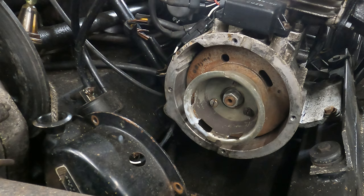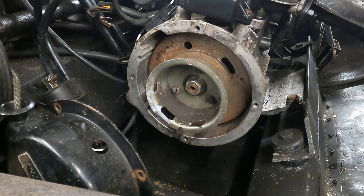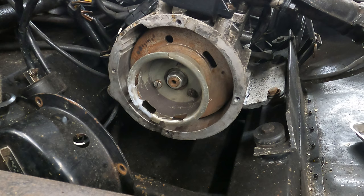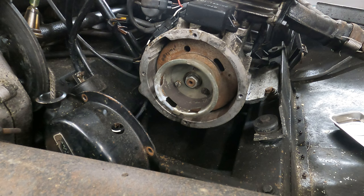So this El Tigre — I just got it up on the lift and I'm looking at it. Is it a points motor? Do you know? It shouldn't be. It would be electronic. Yeah, they were electronic from about '73 up. I don't even know what year this thing is. This is a '79. So this definitely is not points then. Did you put seals in it? No, it doesn't have spark. Check the kill switch — is it up in the throttle? Yeah, that's part of the culprit. They made them that year so the kill switch was hooked to the throttle as part of the cable.